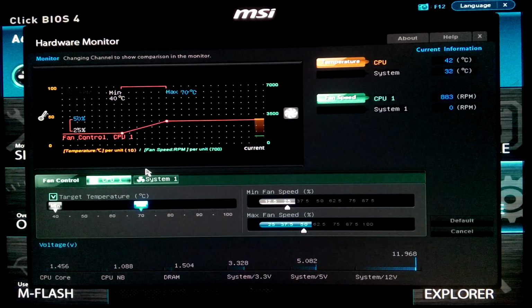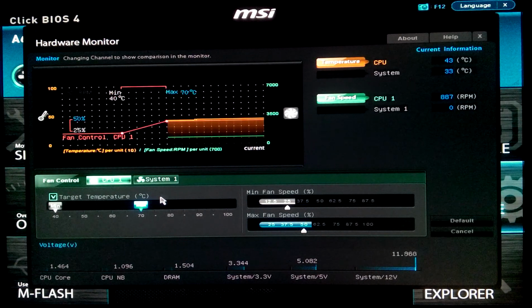And how I set up this fan, you can see that at the maximum 70 degree temperature, I set the fan inappropriately because I don't have a PWM fan plugged in there. But if you have a proper 4-pin fan, then you will want to put 100% fan when the processor is at 70 degrees, or 65 is much better. So let's see how we can set it.